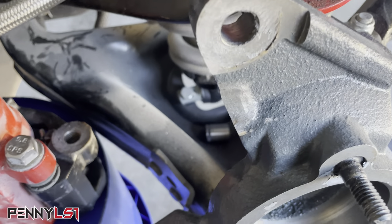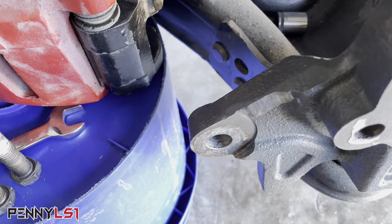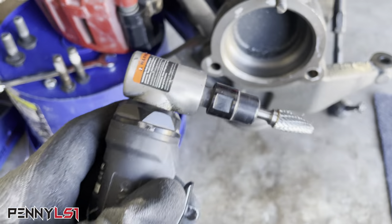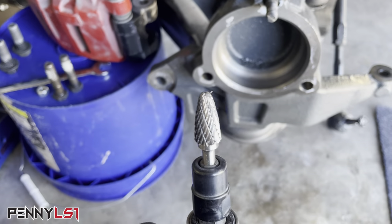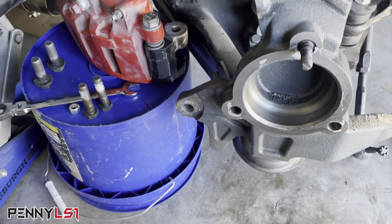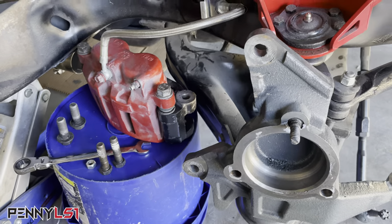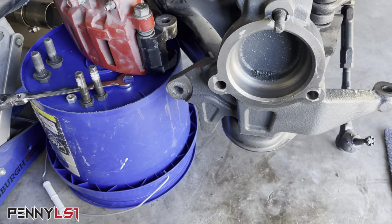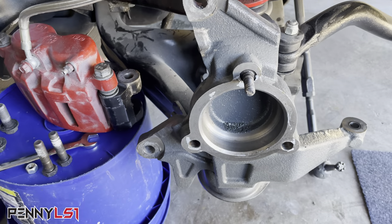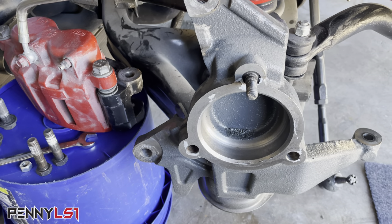You can see how much material I had to take off to get that bracket to go flush. Using that carbide bit it was like cutting through butter. This is just a die grinder — you can use a Dremel, or actually do it with a grinder. With the grinding wheel or flap disc it'll cut right through this. I believe that's... nope, it's steel. Steel, cut through it like butter. So that's the first modification you're going to have to make. Let me mount the bracket on there and I'll show you the second modification, which is also the same one you have to make on the stock blazer spindle for bolt clearance for this bracket.